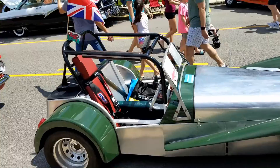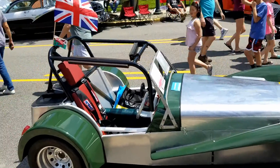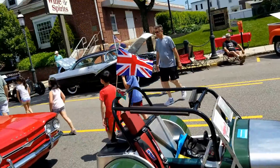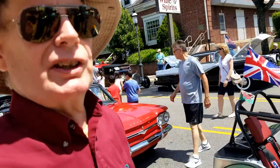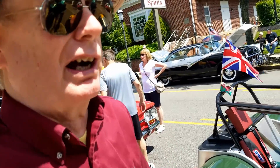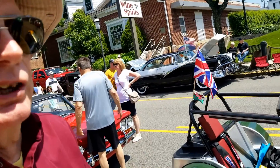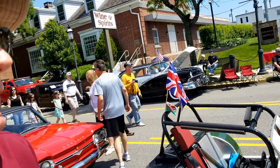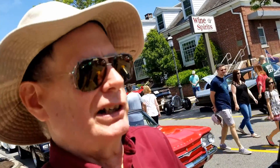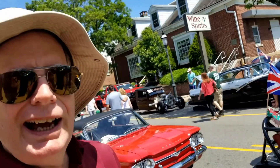Are we allowed to pop the hood there? We can, though I had so much trouble putting it back on. Under the hood it's a 1500 Cortina bored 40 over, and it's got dual Weber carbs, four into one headers, 10 to one compression, and it goes pretty good.